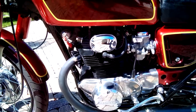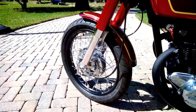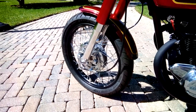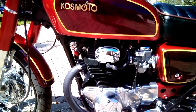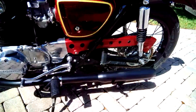All the chrome has been buffed on the buffing wheel. The aluminum hubs were vapor blasted and polished as well. The rims — not the hubs — were painted satin black, just like the engine, which also got satin black.